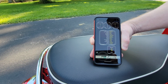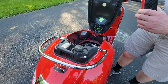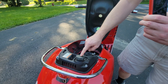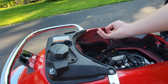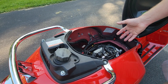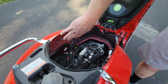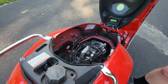There's nothing in there except the O2 sensor. What happened? I think it's a common thing. If you overfuel — and we all know as GTS owners how easy it is to overfuel — the fuel got down inside the evaporative system. Underneath here there's a charcoal canister that filled with fuel, which added that fuel to the system. The O2 system couldn't compensate for that much fuel — this was completely flooded. I think that's what my problem was. Once it dried out, it was fine.